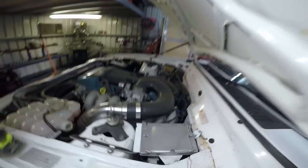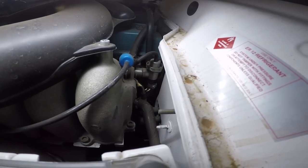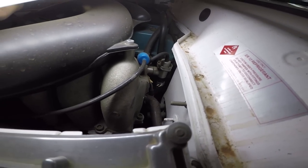For the connections, as I said, all the XG lines will match the XF body, so they'll go straight in there, pop rivet them on, and you'll be sweet. Come up through the top here, you've got the fuel rail, and that's just got some fuel hose clamps connecting the XG lines on. Pretty much that's all I did. I just cut off the clip fittings on the XG so I could use the hose, which hasn't come off yet, and I know I've done a lot of things with this car, including revving the shit out of it, so it works pretty well.